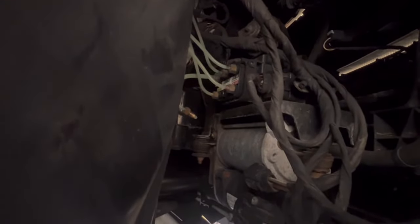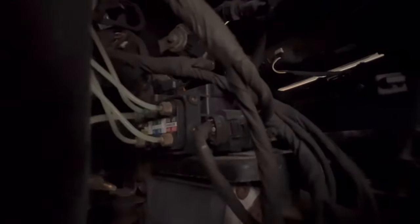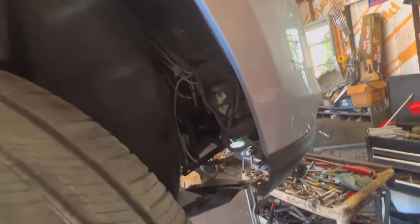This is the valve. I took the line out and the air is not coming out from here. The pump is working, but the left rear is no good — the pump is working but the valve is not pushing air to all four air shocks. So on the right side it's working fine, but on the left front it's weak, so it doesn't go up all the way.